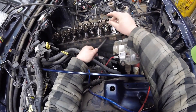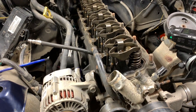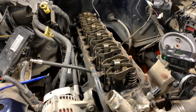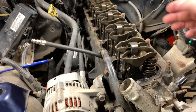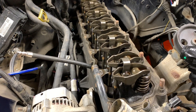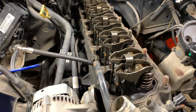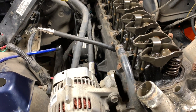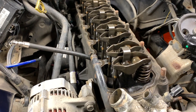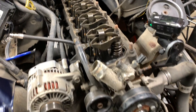What you want to do now is crank the engine over by hand until it's at top dead center on the compression stroke. You don't necessarily need to have the valve covers off — I'm just showing it so you can see clearly. You can stick something in the cylinder, like a little rod, as you crank it over slowly and bring it up to the top. You'll know you're on the compression stroke when you can feel pressure coming up. Let's crank this over.